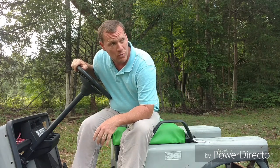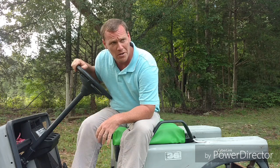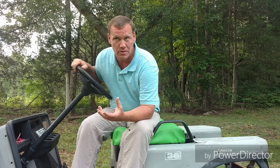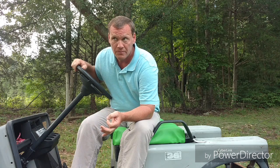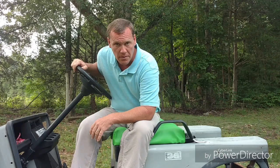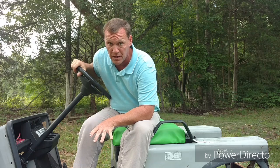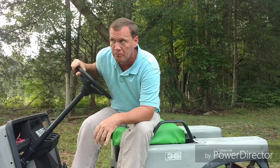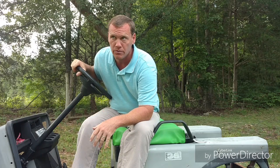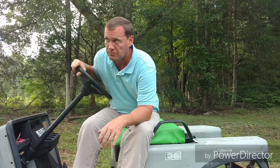At 9 o'clock one night, I'm in there on the couch and I'm thinking, wait a minute, this is a Predator. This isn't one of those little mini bikes. So I go out here and the throttle stop screw is not spot welded and you can turn it freely. So I fire up the cart, I back that throttle stop screw off, and I take off down the road in what used to be a 13 mile an hour cart, because remember I changed the sprocket. It goes immediately over 20, 21, 22. I'm talking about immediately, just backing off that screw.